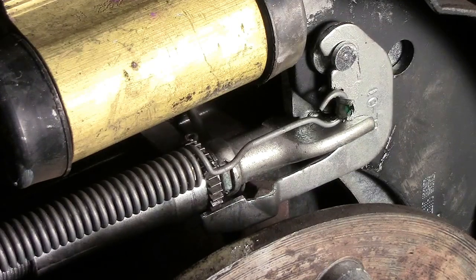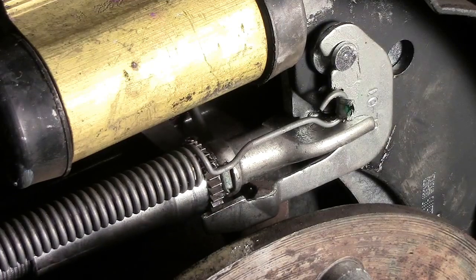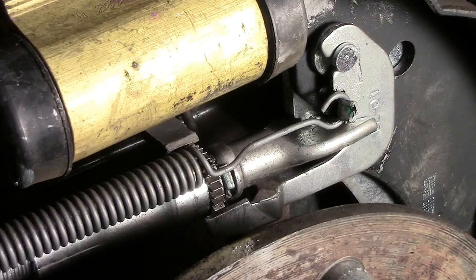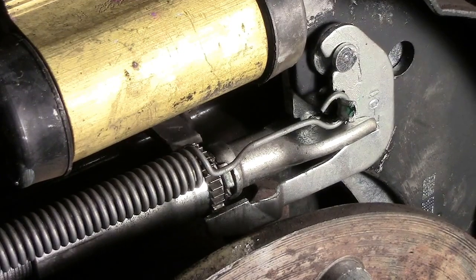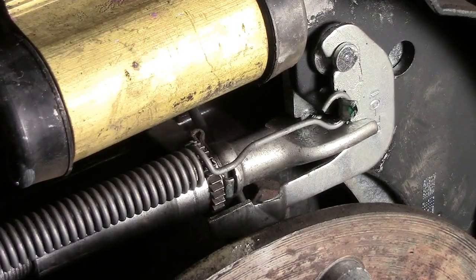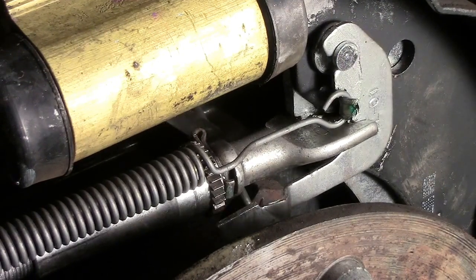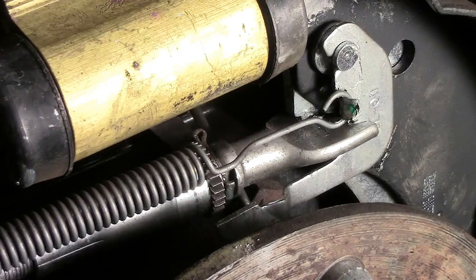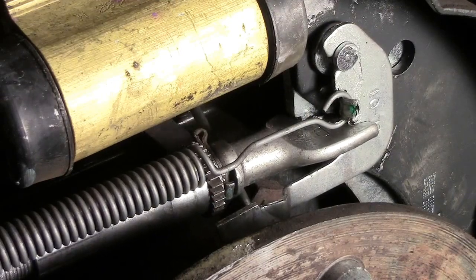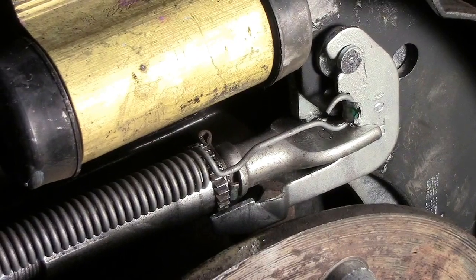Before releasing, notice I can't move it — I can't pull my chisel down from the end I'm on because it's locked. That means if I lift my chisel up it's going to be adjusting the brake outward, but I want to go the other way, so I need to push the chisel down. After a couple hundred turns and a lot of aggravation — holding that arm out, getting your chisel on the star wheel, going one notch at a time — you can back this off so that the shoes compress closer together, and then you'll be able to pull the drum off the shoes.